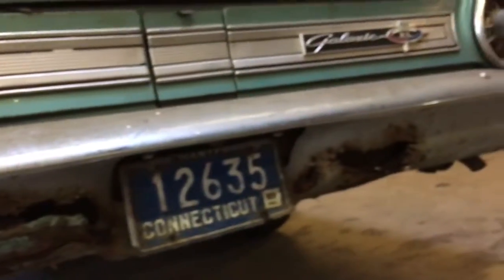I can't really tell in the video because it's kind of dark — the lighting in here isn't great. If you look at the pictures I took with better lighting under the car, you can get an idea of what you're looking at. The rocker panel actually isn't that bad on this side — the rocker is pretty solid. The driver's side looks pretty nice; the passenger side is worse. This is the driver's side quarter panel and you can see it's all rotted behind the wheel, which is typical for these cars. The back bumper is rotted pretty bad — it's shot, there's no saving that.